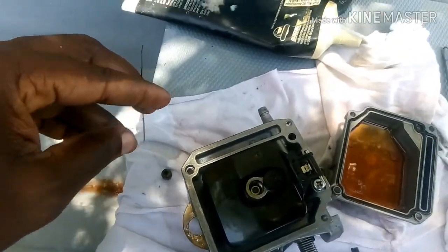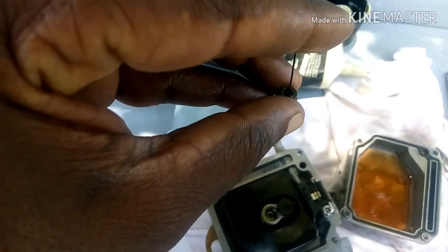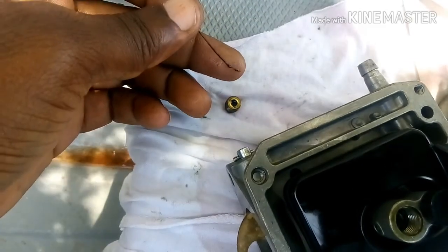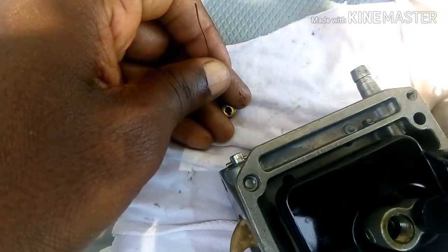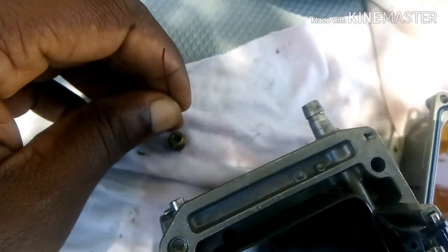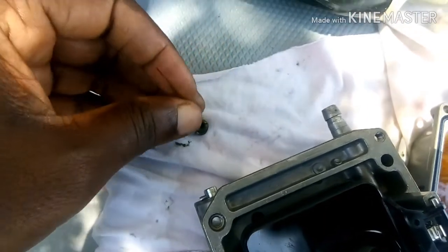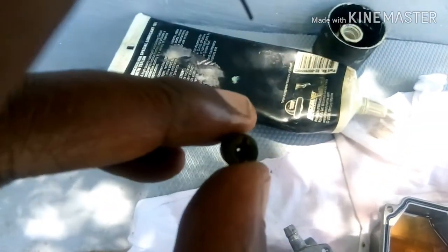What I'll do is take a small piece of wire and clean this out. You can see there's something built up inside — like a very thick grease or varnish. You can use carburetor cleaner or some kind of cleaning fuel to clean this nozzle, and the problem should be solved. Now you can see the hole is clear — before, you couldn't see it because it was blocked.